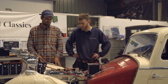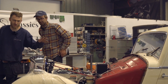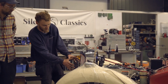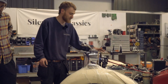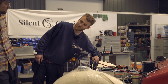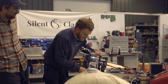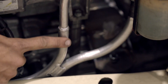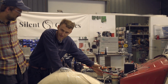The coolant lines - only the best, right? We've used the original radiator, because if we used a small one you'd see straight through the grille and it wouldn't be very aesthetically pleasing. We've machined up some reduction spigots to bring it down to the required pipe size, and then manufactured these hard lines which we bend and fabricate in-house, just to make it look aesthetically pleasing and provide the necessary cooling.